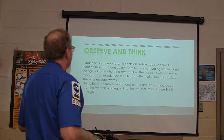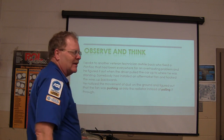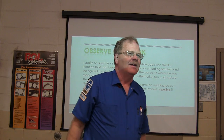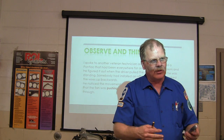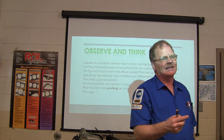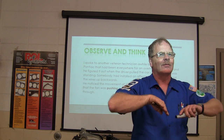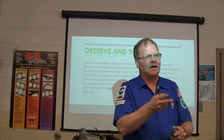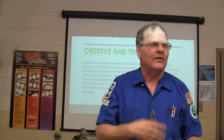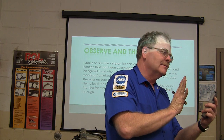All right. So I spoke to another guy a while back that fixed a Pontiac that had been everywhere for an overheating problem. Nobody could figure it out. And when it pulled up, he saw the way the dust was blowing. And he said, somebody's got that radiator cooling fan wired up backwards so that it's blowing into the radiator instead of pulling air through it. And all he had to do was take that aftermarket fan and switch the wires around on it, and overheating problem solved.